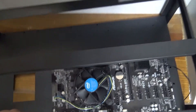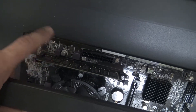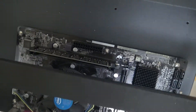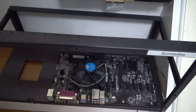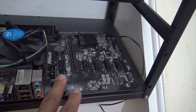As far as memory, all you need is about four gigabytes of RAM. This one's eight gigabytes because I got it on sale on eBay, but you only need about four. The motherboard and computer themselves don't require much, but you gotta get at least four to six PCI lanes — or more — on the board.